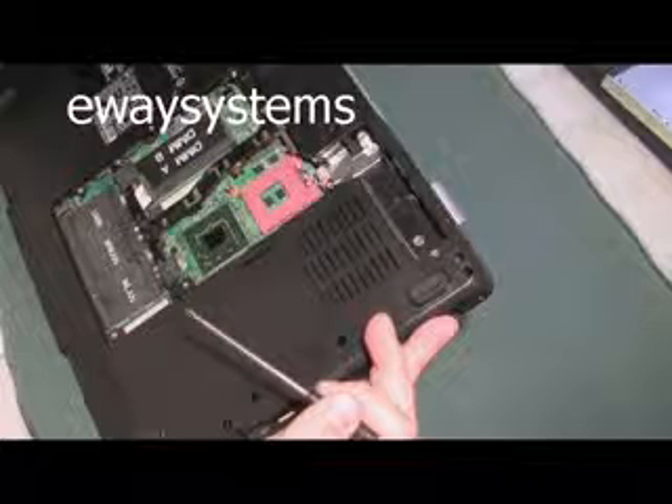Let's loosen up these wires - we're going to have to get them out of the picture. This is for WLAN, this is for WWAN which is like a mobile broadband card, and this is your Bluetooth - the blue wire. They usually make the Bluetooth wires blue, just so you know. We're going to have to get these out of the way because when we go to pull the screen off, these all feed up through the top of the screen as antennas. They need to get to the highest point. Also, this is the CD drive, so let's just pull that out - that's one screw. I'm starting to smell beer as I take this thing apart. This feels kind of sticky.